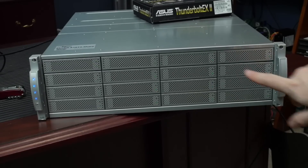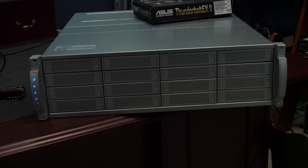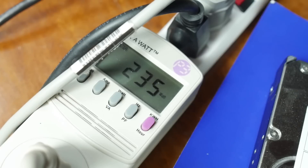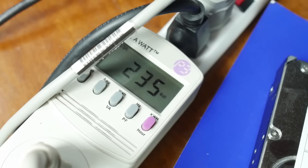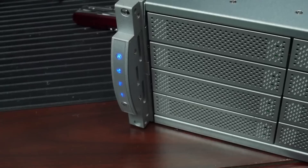We have this because we're doing a lot of video production and need something not just for archive but for work files, and we plan to grow into it. This is a specialty, very niche piece of hardware, but the particular problem it addresses — very fast, quick access to post-production video — it solves brilliantly. It is well worth the money. Overall, it's more cost-effective than outfitting a small team with equivalent 10 gigabit hardware, even if you were to build it on 10 gigabit Ethernet with Windows Storage Server 2012 R2. Thunderbolt actually ends up just being cheaper and easier.